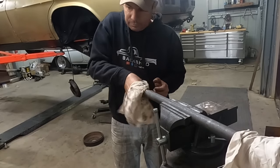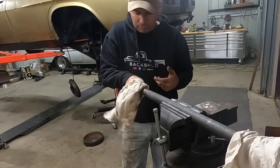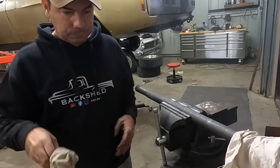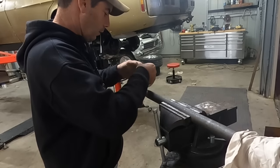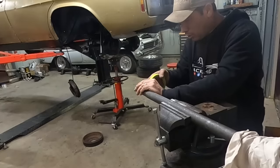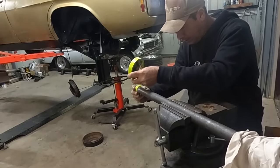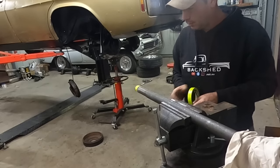Just gonna clean it off with some thinners, because you want something flammable if you're gonna grind. No, because I want the tape to stick. And by wrapping the tape around it, you'll know if you've gone square, because if you haven't, it won't line up with the other side. Sure, you can bend the tape a little. And so, like I say, it's not going to be perfect. It's going to be good enough for me, but...